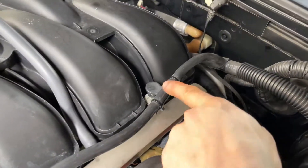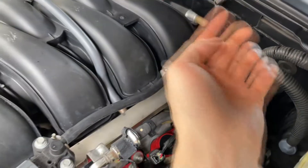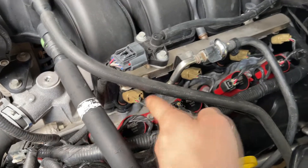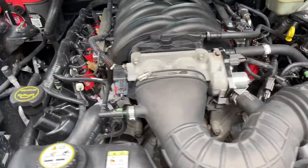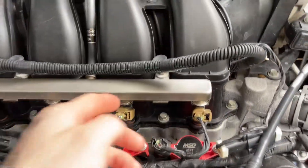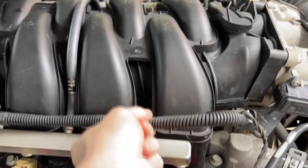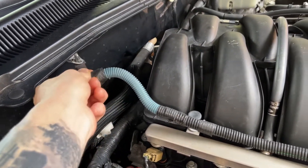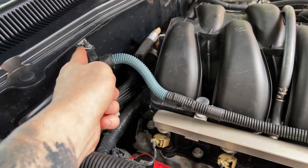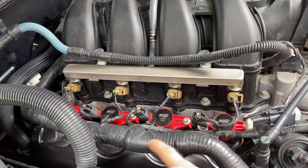You may want to disconnect this vacuum hose from the bolt here — it just lifts up and comes off. Disconnect your fuel injectors — four on this side and four on the other side. Disconnect this harness as well; same as the vacuum line, you pull up and it comes right off the fuel injection rail. There's also a little clip housing that props the harness up — removing that lets you bring the harness out of the way.